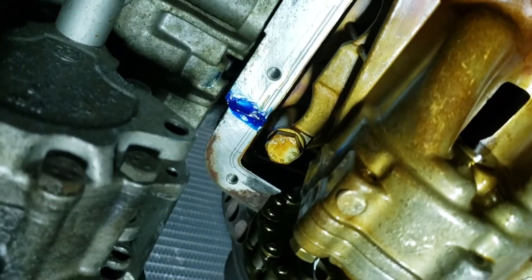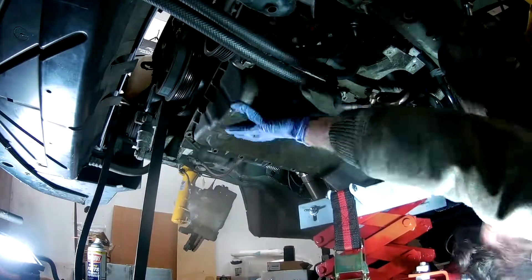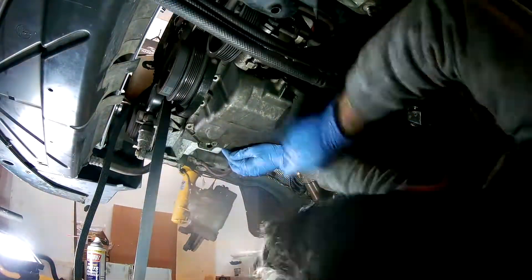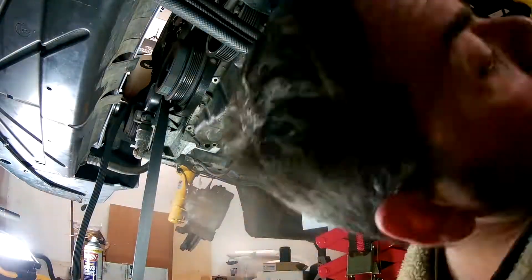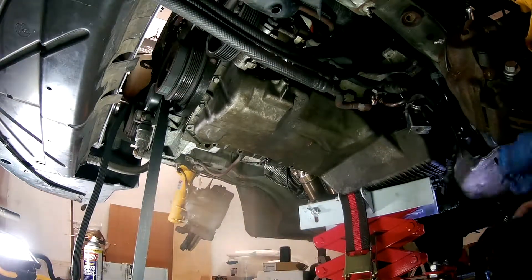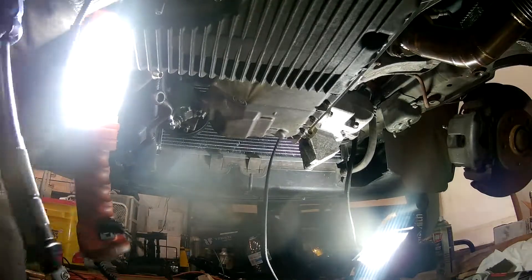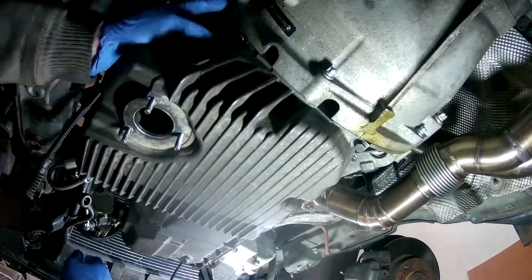With the oil pan gasket surface prepped and ready for a new gasket, it was time to move on to installing the oil pan itself. The transmission jack again came in handy here and provided a third hand to lift the pan as I put a few bolts in to secure everything in place. This was really hard to do because the new gasket liked to slide around a lot, but eventually I got it all in place. Working from the front of the engine to the back and alternating from side to side, I put in the remaining bolts and threaded them down. Then, finally, when all bolts were threaded in place, I torqued them down to the required 7 foot-pounds for the 8.8 grade bolts and 9 foot-pounds for the 10.9 grade bolts that pass through the transmission bell housing.